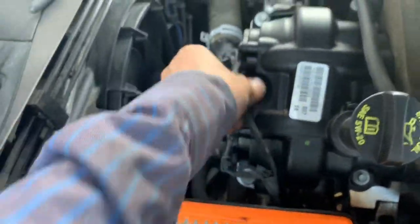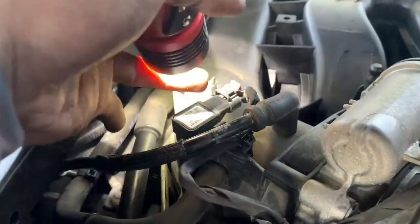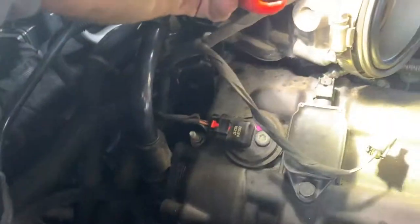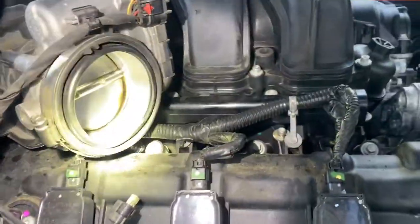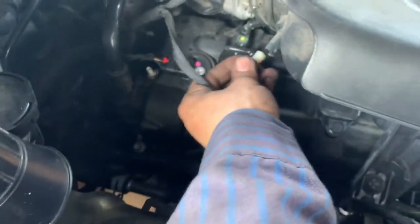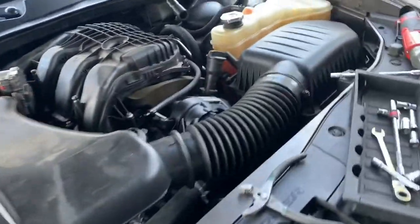I just got finished with the left side - put all the brackets back, the 13, the 10 right here, and the other 13 down there. Connect everything you need on this side and don't forget the two connectors right here that you disconnected. Now on the right side, reconnect your PCV hose, your vacuum hose, the one for the throttle body, and the two connectors. This one's for the air tube. Tighten down all your manifold bolts, tighten down the bracket, the two 10s on the side, and the 13 right there on the stud. Get the air tube back and reconnect the sensor and PCV hose.